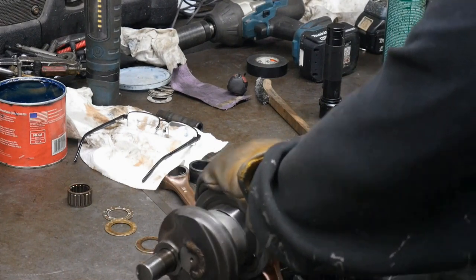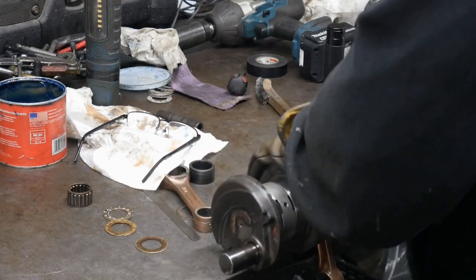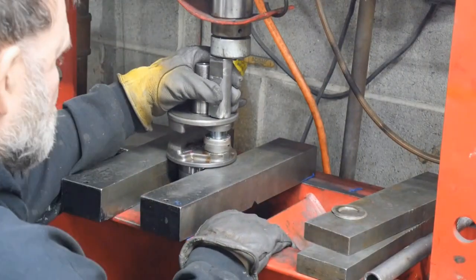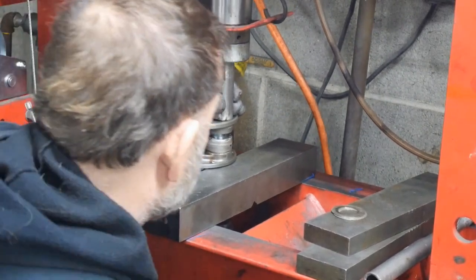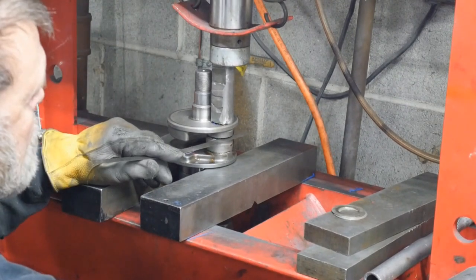I'm tapping it, laying it on the table. What I'm doing is hitting the counterweight down onto the table because it was out of alignment a little bit. You can hit both sides down on the table, and the table is relatively flat, so usually it'll be within 10 or 20 thousandths. That's kind of what I was doing, blocking your view. That's another 20 thousandths feeler gauge.